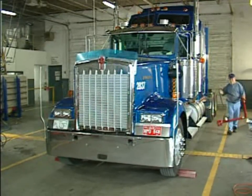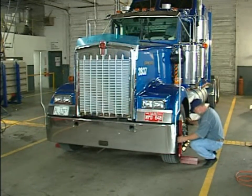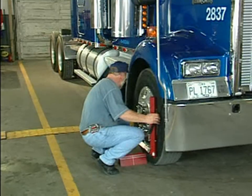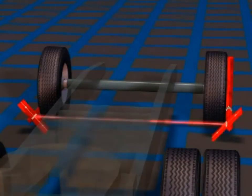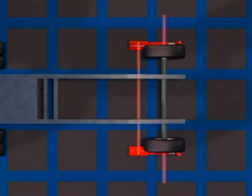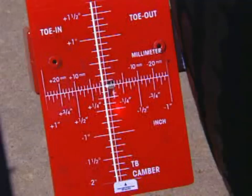Now we move to the steer axle. At this point we're going to use the laser that shoots out of the side of the laser bar, out of the center of the target that's attached to the bar. The bar itself and the laser shooting out of it form a framing square. The bar on the other side of the truck and its laser are also a framing square. If these two lasers hit center to center, there's no toe in the axle. But if the lasers are off, one side will be on zero and the other side will give us the toe reading or the camber reading. The first illustration showed camber, the second illustration shows toe, demonstrating a slight toe-out condition in this axle.